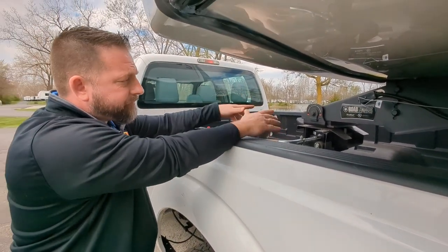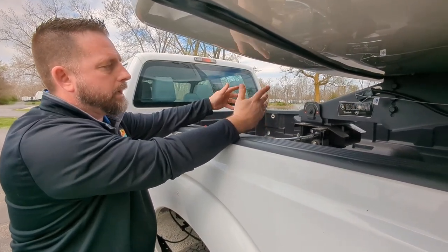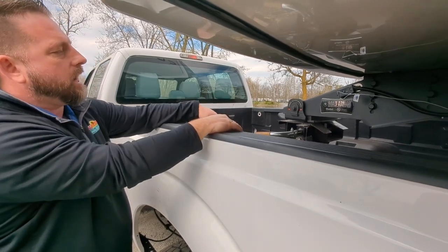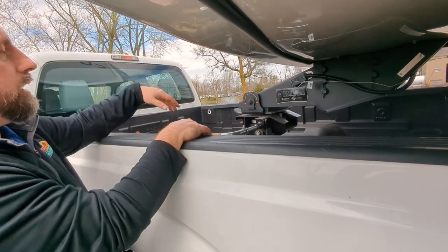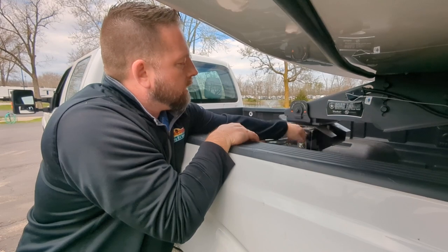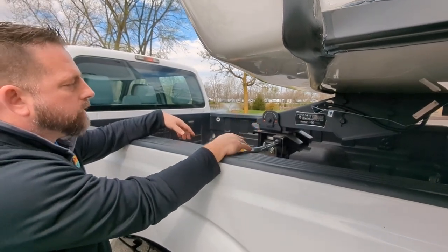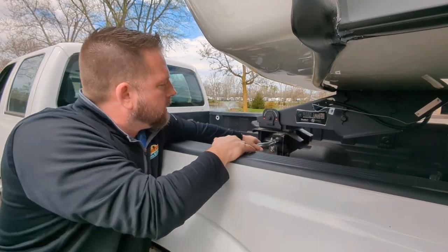Also, sometimes kingpins get worn out. These things are bouncing and getting pulled down the road — it is just metal on metal. You have a lube plate in there for the turning and stuff, but over time that metal can fatigue. There we go — good example: it didn't stay locked in place, which could be a problem when getting unhooked. Now I've got it locked. But if you're pulling and you can't keep it locked, that's why they put in this secondary hole — you can get a pin and stick it in there to keep this out. If you don't have somebody to help you hold this handle, we run into that sometimes: people trying to unhook just can't pull it out of there because this thing keeps going back in on you.